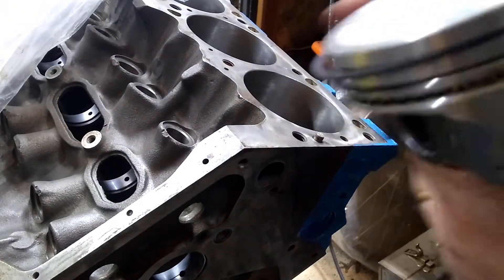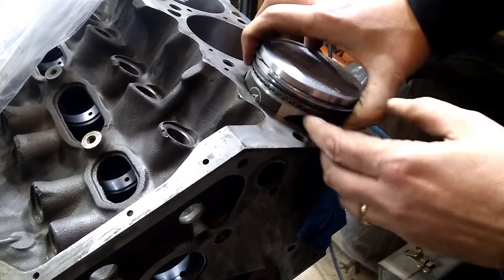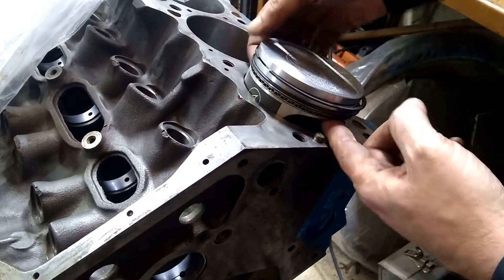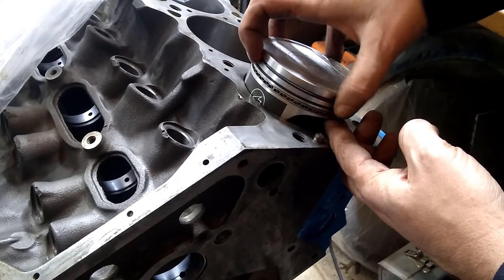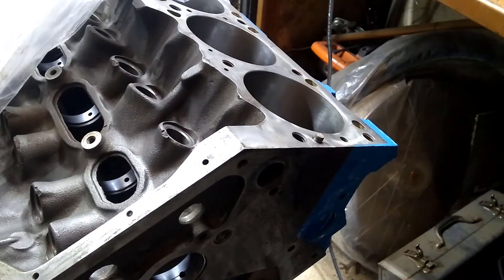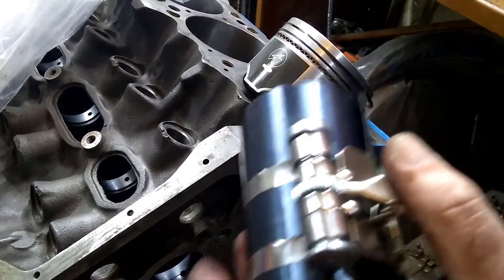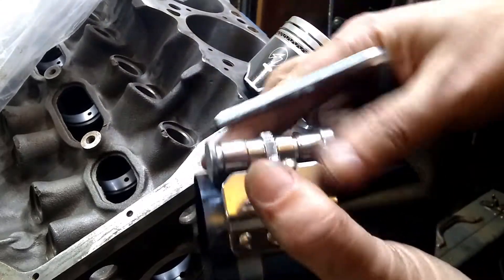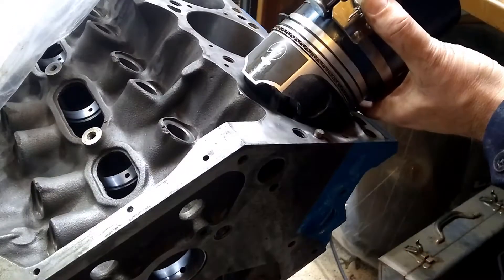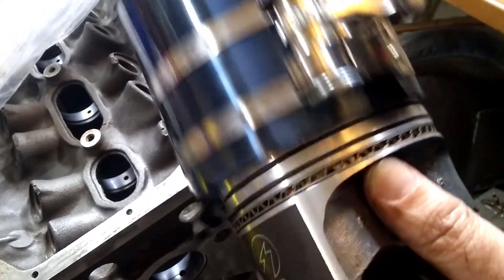First step: as we're putting this down in, these rings are not going to want to go past this edge — you have to squeeze them down into these ring grooves. There's no way you can do it by hand, and if they're not squeezed all the way in when you try to push it down, you'll break one of the rings. That's why you need a ring compressor. The ring compressor is just basically a band — this one has a little ratchet mechanism. I can open it up so we get it larger than the piston and the rings, so that we can slide it down over the top of them.